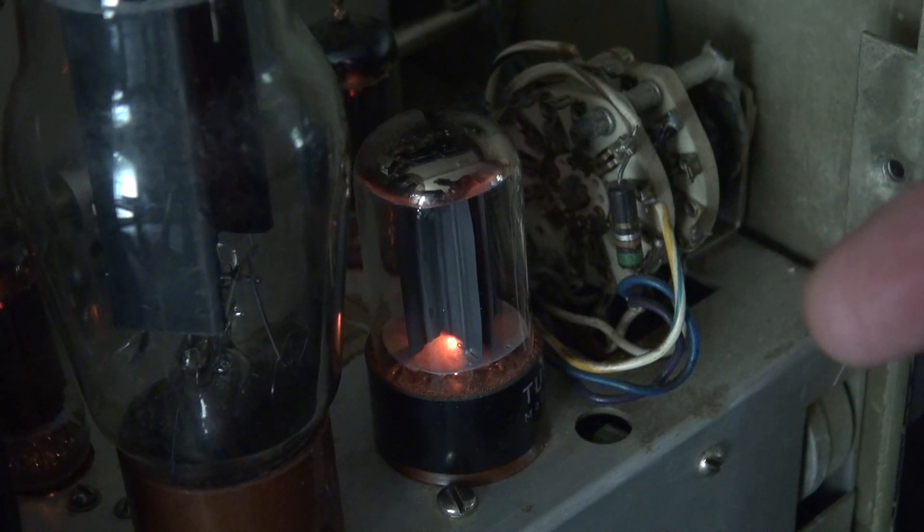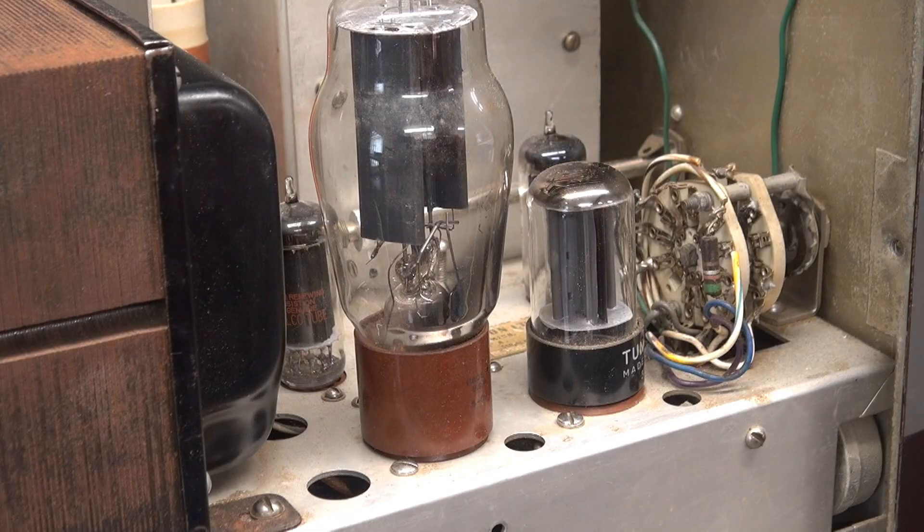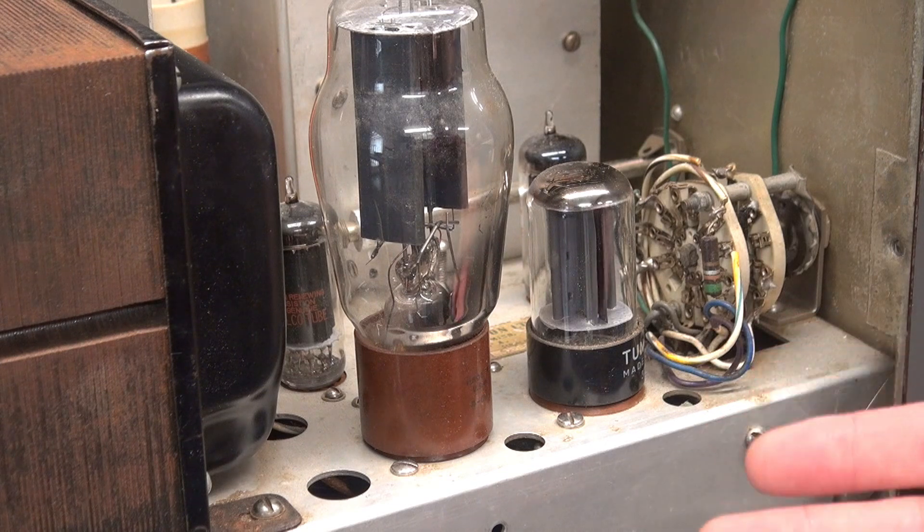That's the point you don't want to get to. The best thing to do is get a push-to-talk system installed so you don't have to flip that switch anymore. To stop the arcing on that switch, the solution is to install a push-to-talk system. So instead of having to rotate that switch, you're simply going to squeeze your microphone like you would any other radio. You can come up with your own system — it's no big deal.